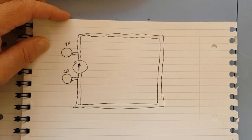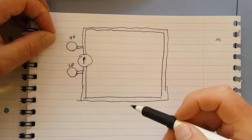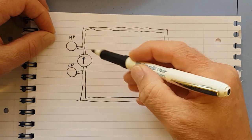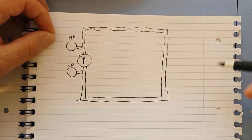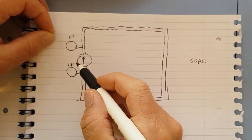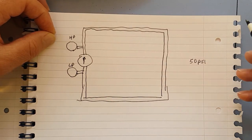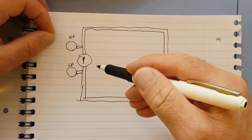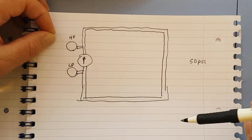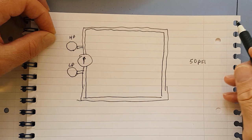Before we get on with it, let me give a quick explanation of why we see pressures within the air conditioning system. Imagine a loop of pipe with a compressor on it, filled with gas at 50 psi. If you measure the low pressure side or high pressure side before the compressor starts, they're both at 50 psi. When the compressor runs, the gas just goes around in circles with no change in pressure - just like coolant circulating in a cooling system.